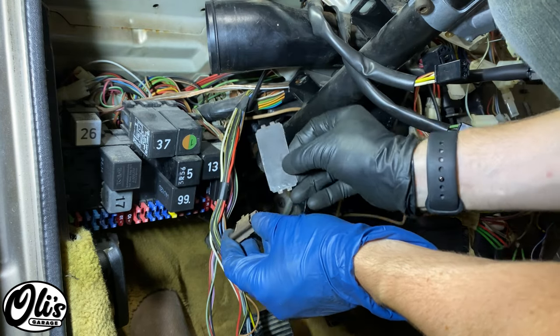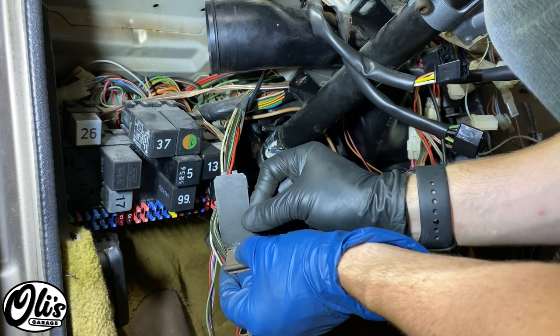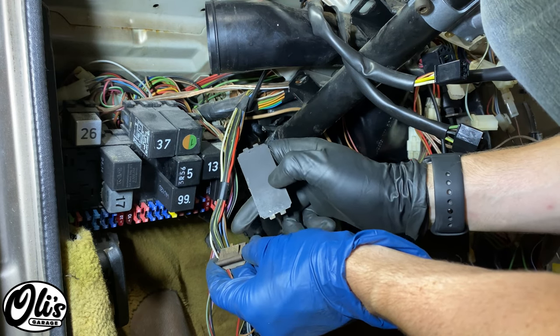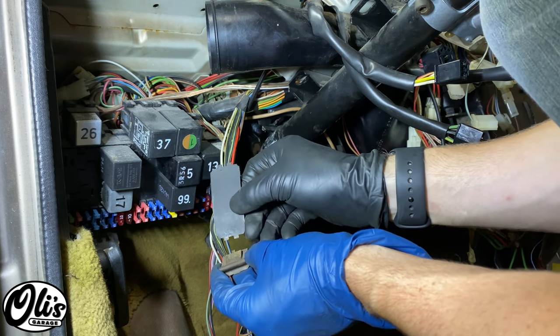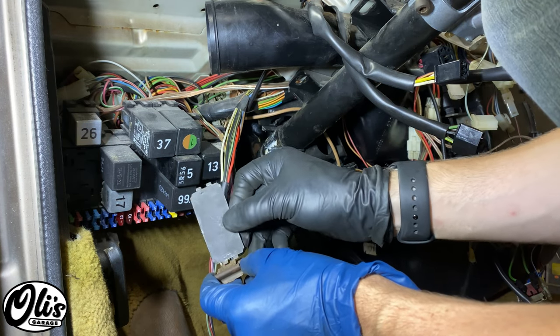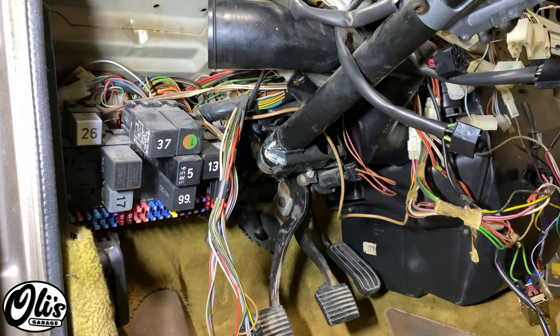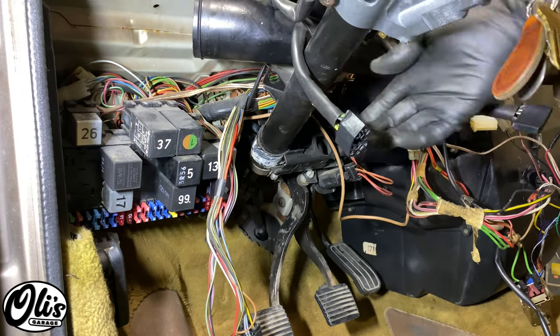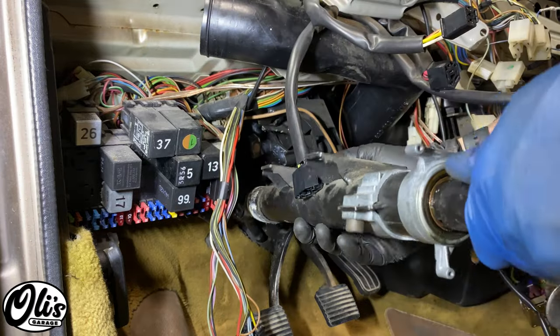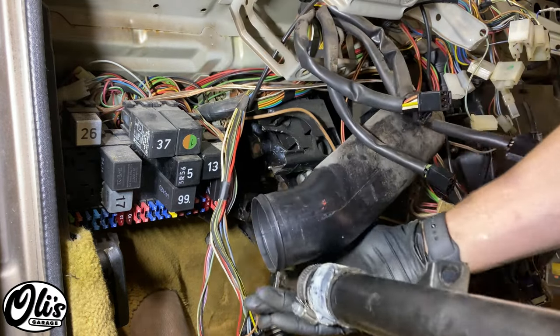The way the system works is you have this tab that's up there and on the bottom it's held in right here by this little lever. So I push this down with my screwdriver kind of one corner at a time and then pry this black one with another screwdriver — you just have to fiddle with it for a little while. Our steering column is now free except for the U-joint down there, so you can slide it out and then just carefully pull it out of the U-joint.